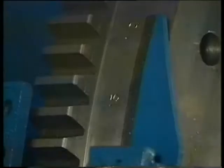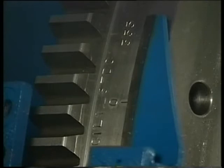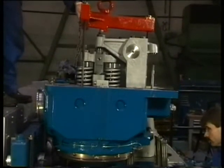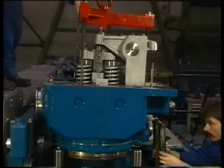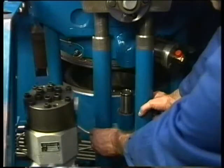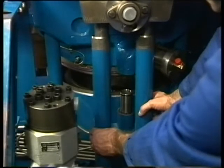Turn the cylinder in combustion top position so that the inlet and the exhaust push rods are placed on the base circles of the cams. Now cautiously lower down the cylinder head over the cylinder head stud bolts and guide both push rods down through the passages in the cylinder head. The push rod protecting pipes need to be guided as well until they fit properly in the cylinder head.